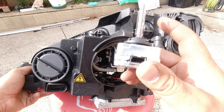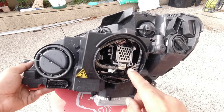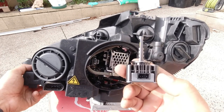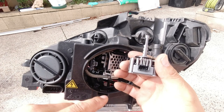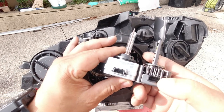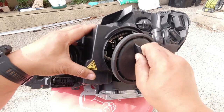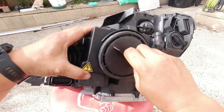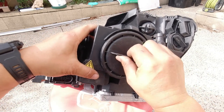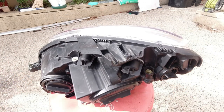You probably can't see it properly, but there are three pins inside this plug for the D1S style headlight bulb, and it's also the same for the LED as well. There are three pins, and they're positioned exactly the same as the HIDs. The pinouts are exactly the same — that's really all there is to it. Then you simply grab your cover — it tells you on the cover which way is top, so you put that back on and turn it clockwise.